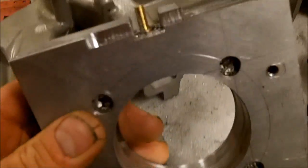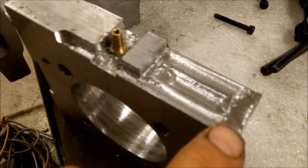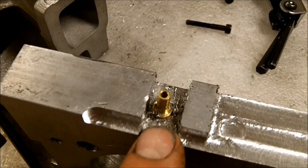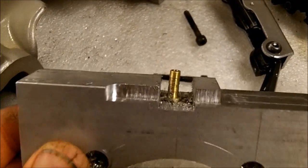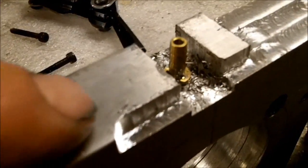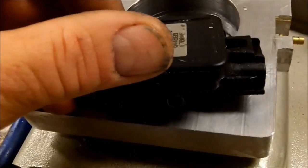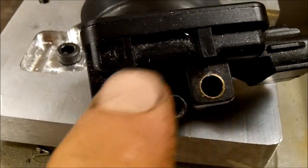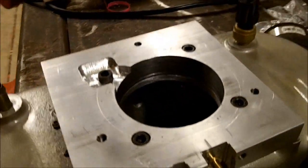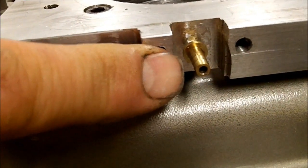Alright, what I've got here is the one-inch spacer that I originally started with. Right here, got the hole drilled in it, I milled out this section right here, and installed a 1/8-inch barb fitting. This is a male-to-male fitting. On that one-inch one, I had to actually mill out this section here so when I installed it, it would clear the parts of the MAP sensor. Here's where I went to the 3/4-inch one, and I have it all milled, drilled, and you've got the barb fitting in.